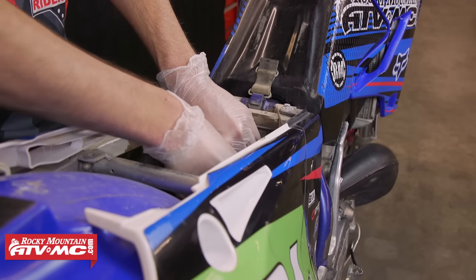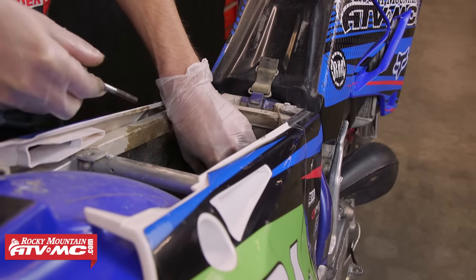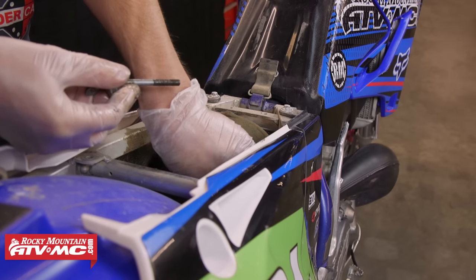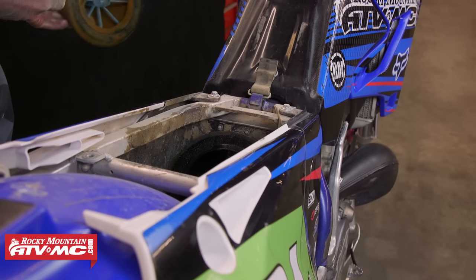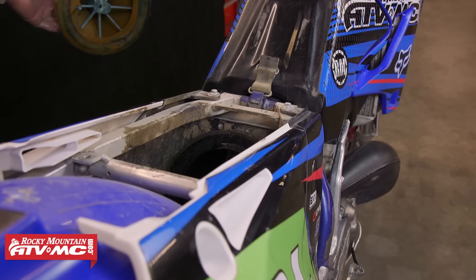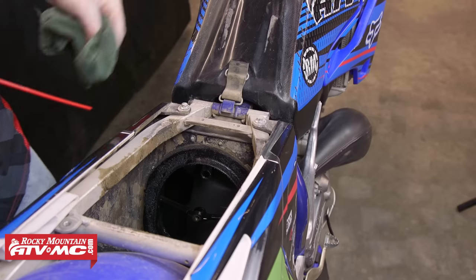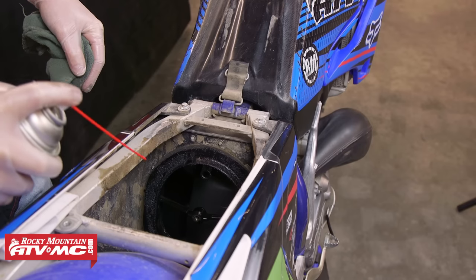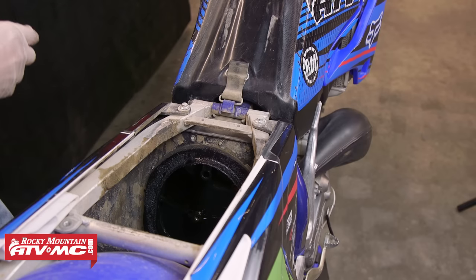It's always a good idea to use rubber gloves when you're working with your air filter — they're messy when you're taking them out and when you're putting them in. I've taken the bolt out and I'm just going to pull the filter away from the cage and pull it out. Even if you're careful, there's a good chance things could fall into the air boot, so it's always a good idea to inspect the air boot and clean any dirt that may have fallen in. It also gives you a good indication on how well you're cleaning and oiling your air filter. I'm going to quickly spray the air boot with some contact cleaner or WD-40 and with a clean rag, carefully wipe it out.